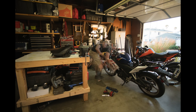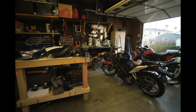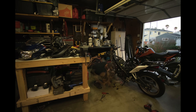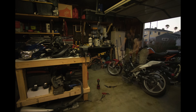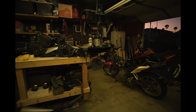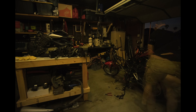The first thing I did was disassemble the 250. This was super easy and accomplished in mere seconds. The only thing that was a pain was the electrical connector under the fuel tank, which was kind of hard to get to. I ended up just cutting that connector off, which was fine because when you swap it into the Grom, you actually need to lengthen that connector anyway. Drain the coolant, unplug all the connectors, remove the engine bolts, and lower the engine with a jack or just muscle it down — it's not that heavy.